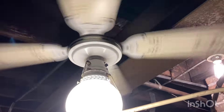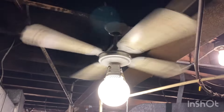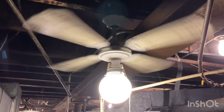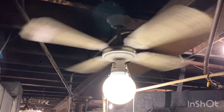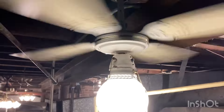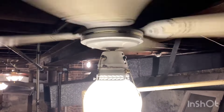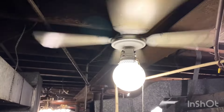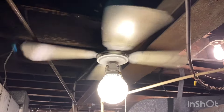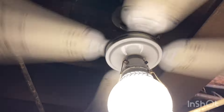Let's go to medium. I remember this one had a little bit of a switch housing issue. On cheap fans, that little flange that's a press fit holding the switch housing to the actual motor shaft had the press fitting broken, so it was flopping around all over the place. What I ended up doing - I did two nuts on the threaded shaft tightened against each other to hold the switch housing in place, and that has worked really well. It's no longer floppy, which is good. Really solid little fan, especially for a Kmart cheapo.